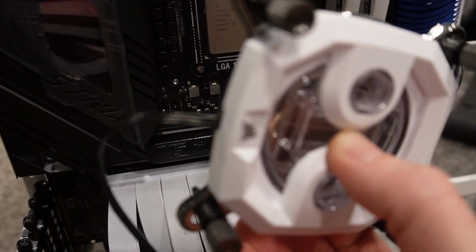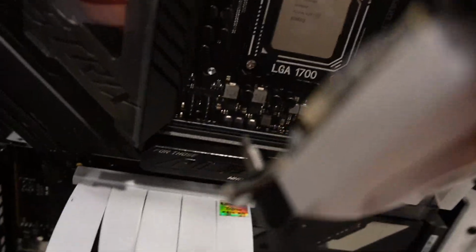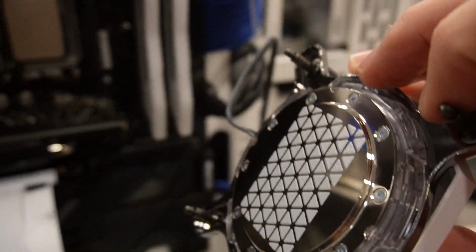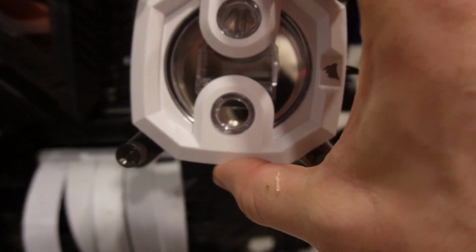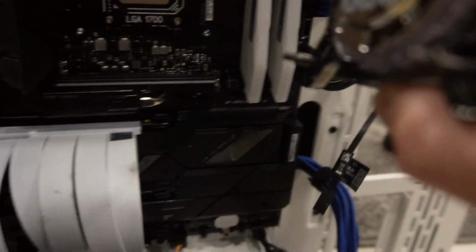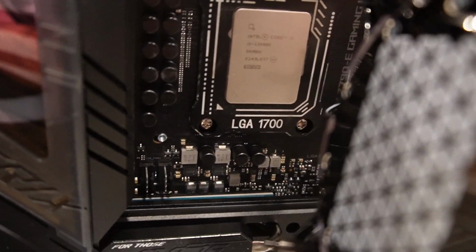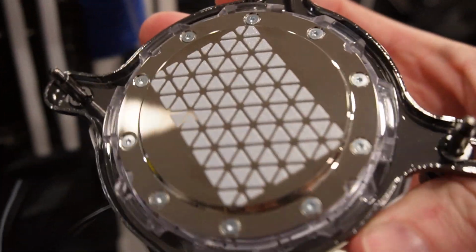It doesn't really matter. They said there's no performance problems with it, and it's probably because of how long that is. But I'll tell you what, I'm gonna install it this way because that 1700 is long, and if you look at this, it's long. So unfortunately, the logo is gonna be on the side. I'm gonna install it like that because, as I said, if you look at how it lines up, if I go this way, I won't really cover the entire CPU with the thermal paste. Now I could do it. I would have to take their, I don't really care that much.